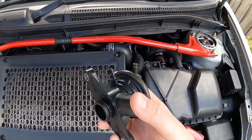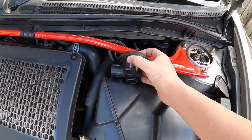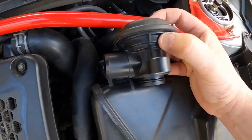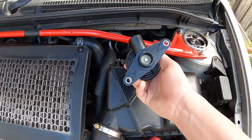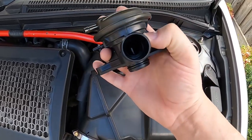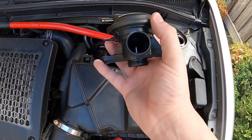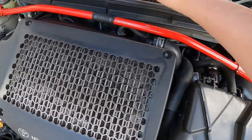This is the factory one — Truong's already taken that off. It does live just here, bolted to the airbox, in what I would call a backwards fashion. Normally you get your pressure from underneath the blow-off valve and then it vents out back into the airbox, like a normal one, which you'd see on most Nissans, Mazdas, Subarus. But Toyota have decided to do it a little bit differently, and I'll explain that in just a moment.